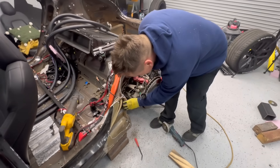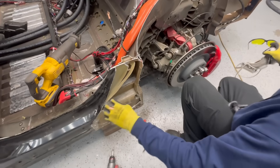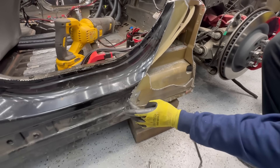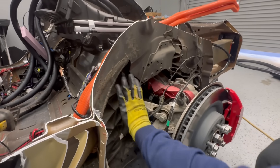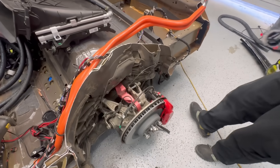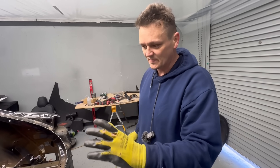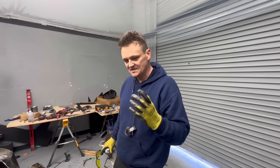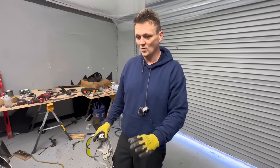The main thing is I did not touch any of the main beam — for example this is the main beam, and there's another one, they're kind of stacked on each other. I cut through this skin, but this right here — see how this is all honeycomb — this is the main thing, it's like one body piece. That actually wasn't as hard as I thought. When I did the Model 3, most of it was a mix of metal and aluminum and way harder. The metal they use is so solid it burns up all the sawzall blades, but this is all aluminum so it's way easier.